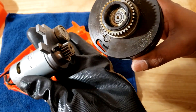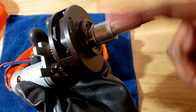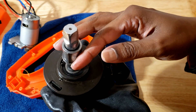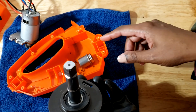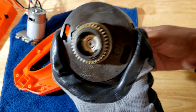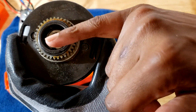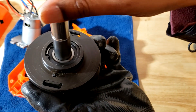You can see this pulls off — there's a little bearing there for this to ride on. All this is doing is the motor is just spinning up this flywheel. We'll look inside. You have a little bushing here like most impacts do on the anvil end, and here you have the shaft — it rides on basically one bearing there.